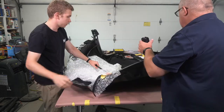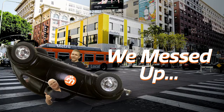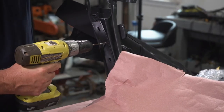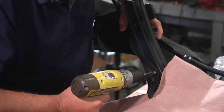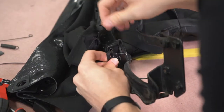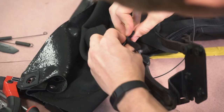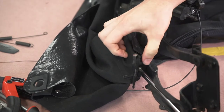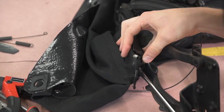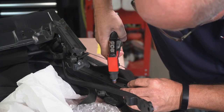It was at that moment when it finally dawned on us — we realized that there was a set plate on the lower B-pillar retainer that had to be put in place before you riveted the top fabric to the B-pillar. We had to drill out the rivets we just installed and redo that part. We ended up having to use a smaller size rivet to save the remainder for the rest of the top, and used small copper washers to make up for the smaller rivets to keep everything secure.